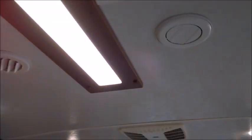This is a vacuum bonded laminated roof, which makes it solid to walk on. And it makes it very strong yet very lightweight. It's an aluminum frame. The ducts go right through the foam, so it's more efficient that way. You don't have an attic to hold heat and pull heat or to put heat into the ductwork. Also, it's sound dampening for the AC, so they run quieter on the interior.